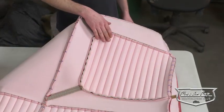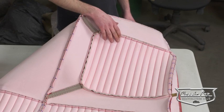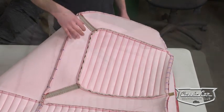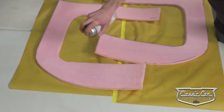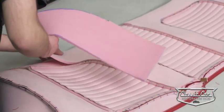Because the seat cover inserts are stitched using half-inch scrim for the pleated sections and only quarter-inch on the outlying borders, we decided to pad it up a little bit using some more half-inch scrim glued into the inside of the cover to give us a nice, full, flat look on the seat cover.